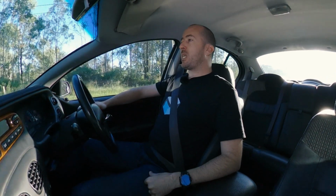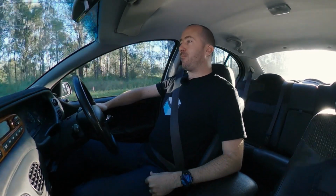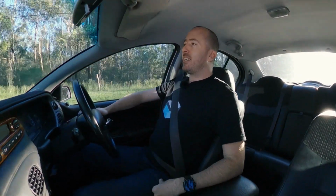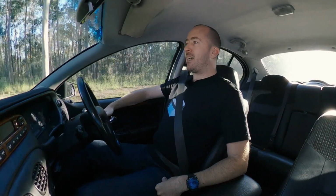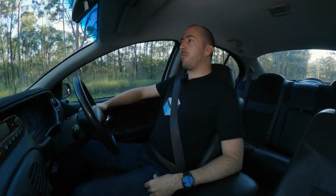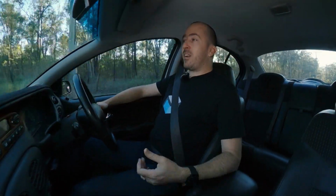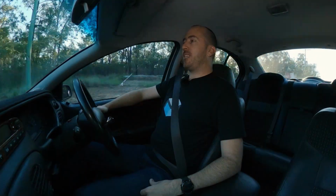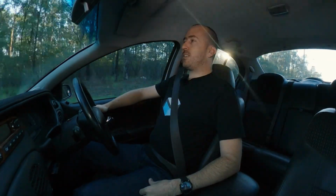So yeah, if you wanted to save your money and you do have the genuine Bosch injectors in your AU Falcon, definitely take them out, get someone to clean them, because they are a valuable commodity, I guess. They do cost a lot of money to buy. Rather than pulling them out and replacing them with an unknown quantity, of course you can, like I did, if you want to pay the money, but if you're counting your dollars, do get the existing ones cleaned if they are genuine Bosch, because they are a quality product.